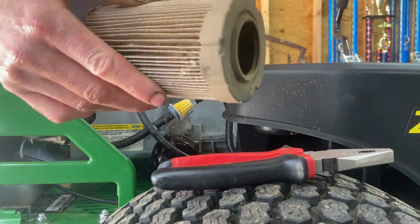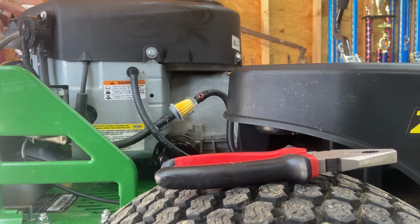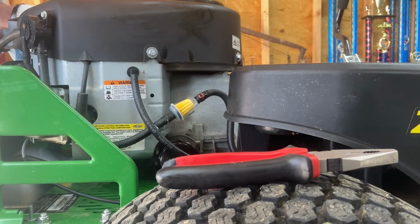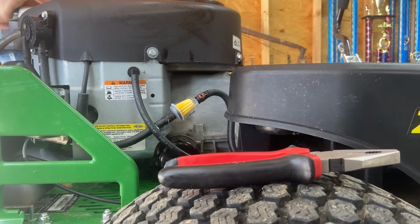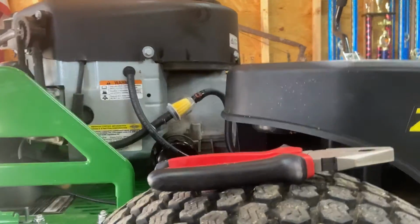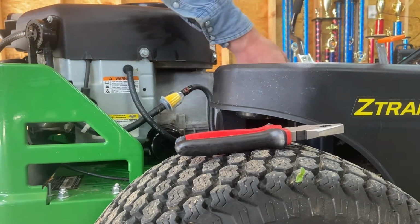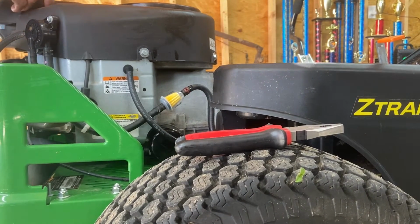You see the air filter, that air filter is pretty clogged up. Put the new air filter in, it just pushes in, and the back side of this housing actually keeps tension on your air filter. So you don't even have a clamp or nothing for your air filter. It just goes on there just like that. Nice, pretty new air filter. Put this lid back on it.